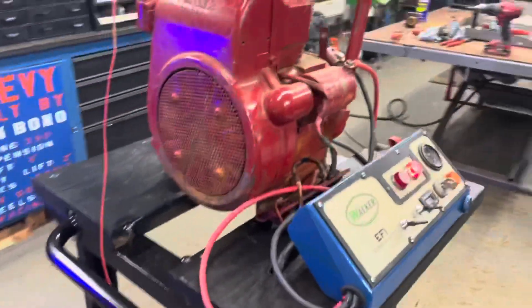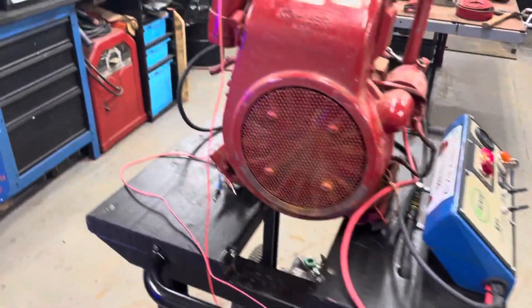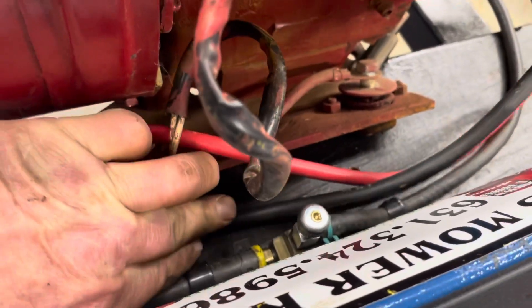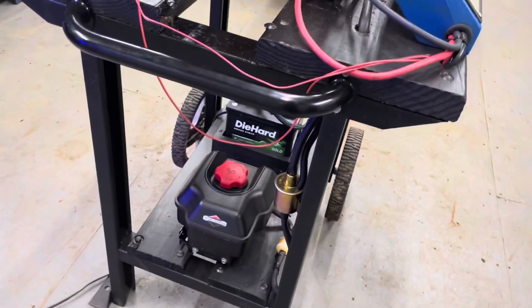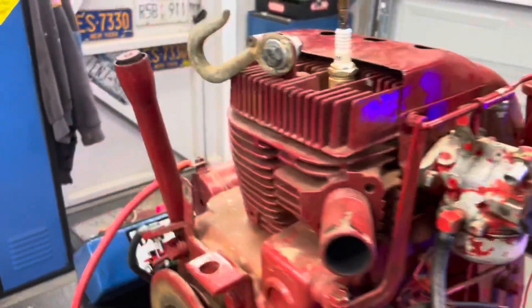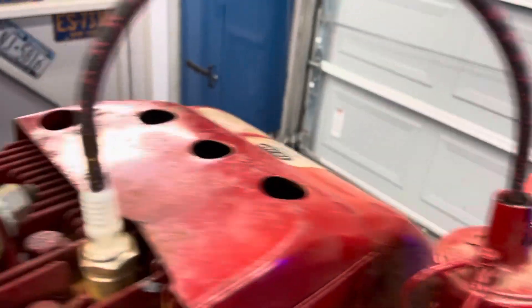The only other problem I have — this wire is for my magneto if it doesn't have an electric coil — is when I put the fuel pump on, sometimes it bypasses the float and comes out of here. I don't know if it's because of the old carburetor or just too much pressure. What I did was turn the shutoff almost a little more than halfway shut, and that seemed to help it. I'm probably going to have to get a fuel regulator to bring the pressure down a little bit, but other than that it works really well. It kind of backfires now because I have no muffler, but I did find a piece of coil wire I kind of made up.